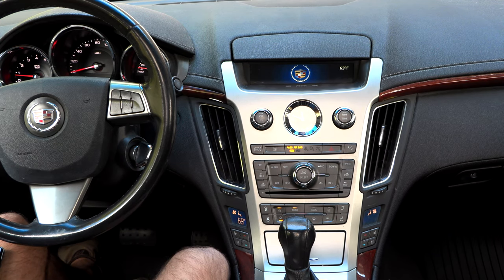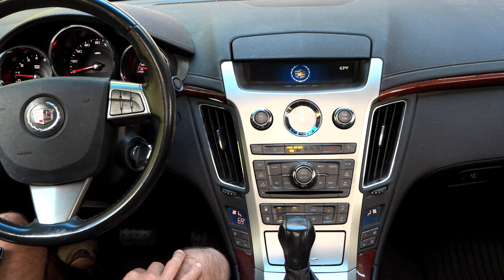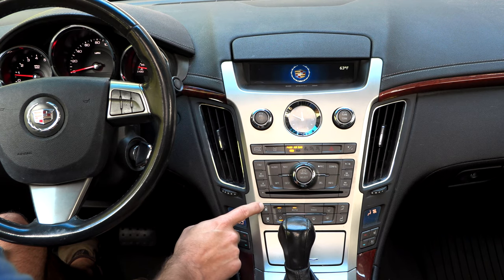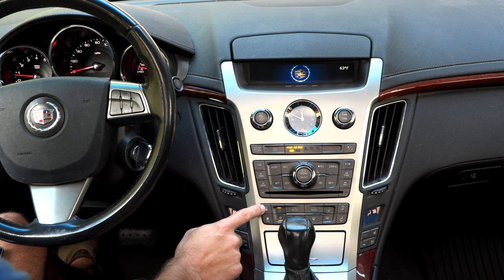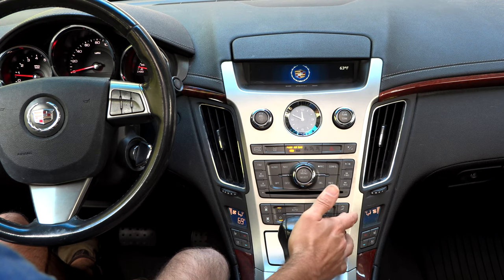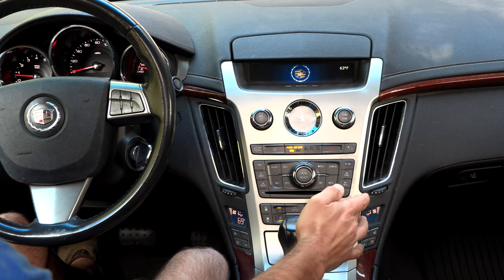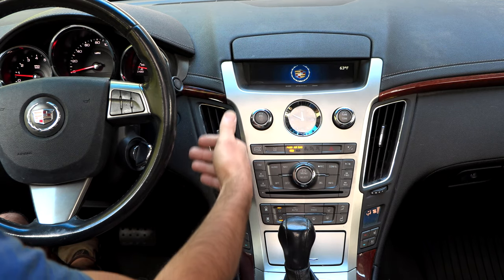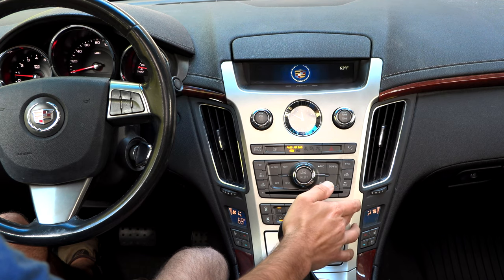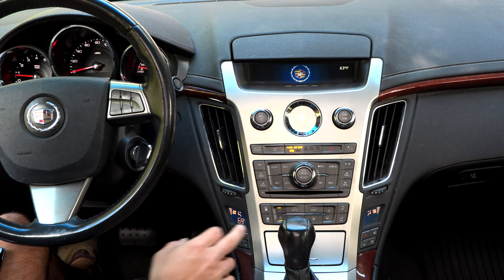Some quick and dirty ways to figure out which door is malfunctioning: if you're having temperature problems, it's probably going to be the right or left blend door. Let's switch this off auto mode and crank the fans all the way up. Let's check the mode actuator operation — I'll mash that down and I can feel the air has changed to the floorboard. Hit it again and now it's the floorboard plus front vents. A couple more times and now it's coming out up top. So we know that particular actuator is working properly.